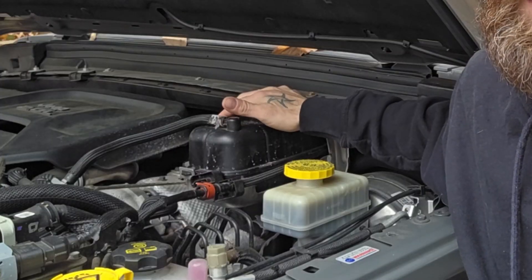The way this cooling issue manifests on these two-liter turbos is usually like this: you're going around driving your business, you've noticed nothing wrong with the Jeep, you don't see coolant leaking underneath it, you haven't really smelled coolant during operations — but lo and behold you're driving along and you get a ding. You look down at your dash and the Jeep is overheating, pegged at about 250 degrees, which is when the overheat alarm comes on on these vehicles. If that's the issue you're having, you need to come right here to this coolant bottle.